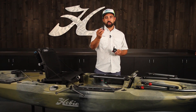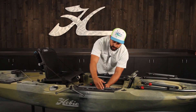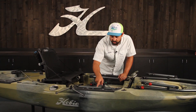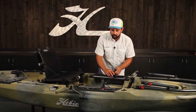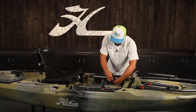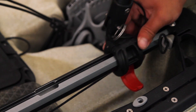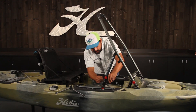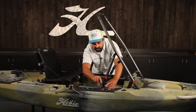The rear legs of your Hobie H-Bar are going to attach to the 2019 Outback using the H-Rail tabs. Make sure the tabs are oriented on the cockpit side of the kayak. Put those in place about an inch in front of where the opening to the track is on the top of the H-Rail — that'll be a pretty good starting point, kind of in line with the very front of the standing pads. From there, you can open the gate on the H-Rail clamp and slide it fore or aft as needed. Come back and insert the pin — I recommend inserting the pin from the outboard side of the kayak so it stays out of the way of your feet and legs while you're pedaling.